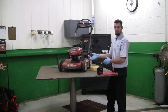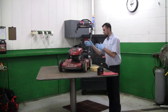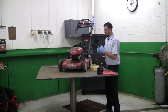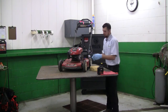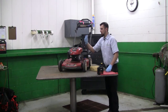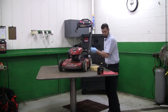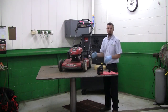We're going to continue on with the maintenance on our Toro mower with the Briggs & Stratton engine, model 20332, and go ahead and change the oil. The cool thing about this is you do not need any tools. The best thing to do is run the machine for 10 or 15 minutes and let the oil get warm. Once it's warmed up, shut the mower down, disconnect your spark plug wire, and when you tip the machine up, tip the air filter side up — which will put the dipstick side down. Remove the dipstick and tip the machine into a drain pan to catch all the oil.